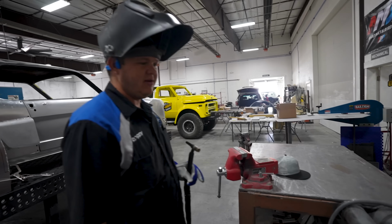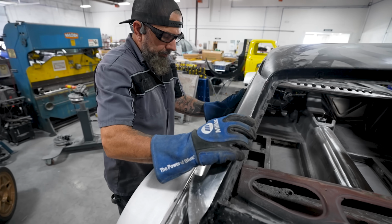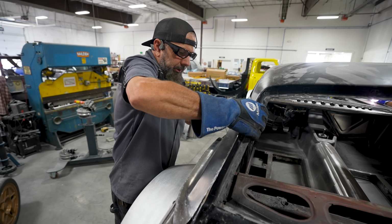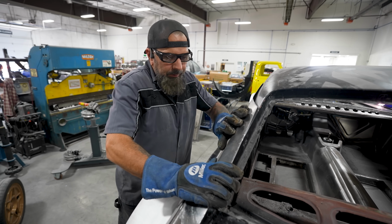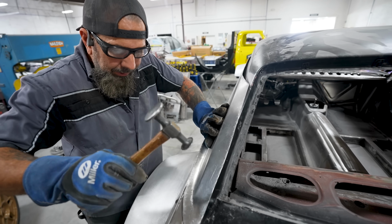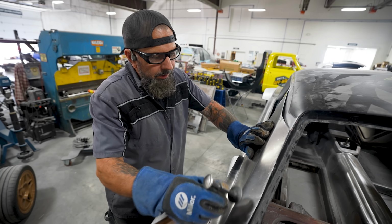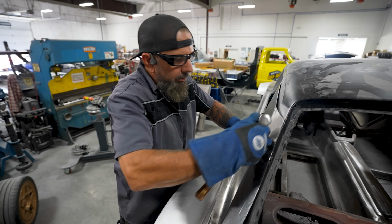Just a little tap here and a little tap there, and whoop, it's rounded. Better. Huh? You can actually cut that out. Clamp that in, roll this down, keep that down. We'll be in business. It's just you're looking at it so high up all the time. Yeah, that you lose perspective of the lower. We can get this to shrink here, it'll curve that line. And we'll roll it in.